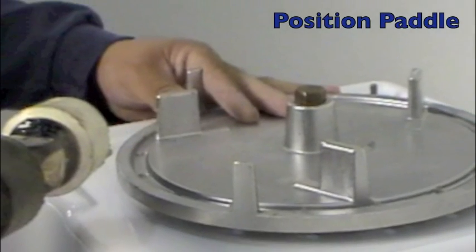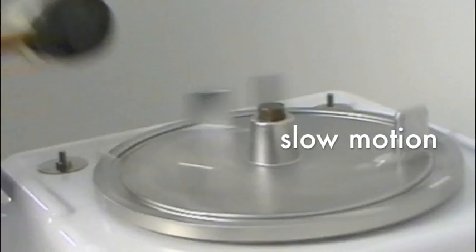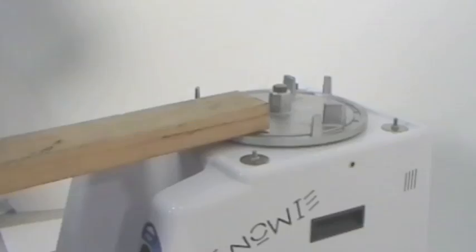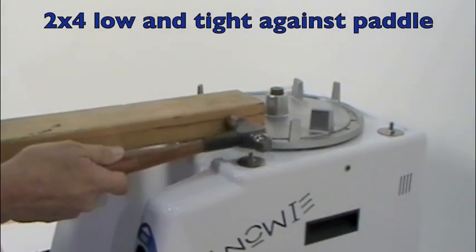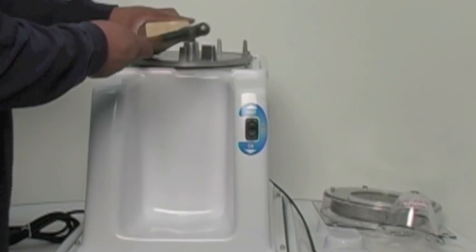Position the paddle wheel and sharply strike the flat edge of one of the heavier paddles on the inside ring with a clockwise blow using the rubber mallet. If this does not work to release the paddle wheel, an alternate method is to place a short piece of 2x4 low and tight against the thicker paddle on the inside ring and strike the wood with a hammer.